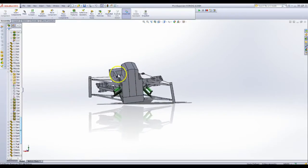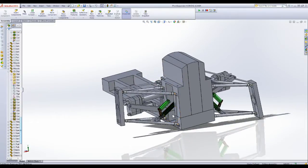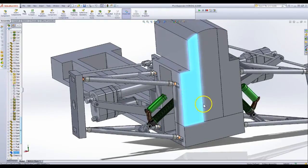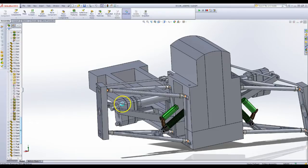The really nice thing about doing all this in aluminum is that it won't require any welding at all to build the car. Once you put everything together, the assembly is literally just bolting things together — no welding, no real fabrication. This makes it a very simple car to put together and also easy to change out parts. If I want to change the design of how high or low these pickup points are, I would just get these two re-machined, change the pickup points, and bolt it all in. I wouldn't have to weld stuff out and grind stuff.